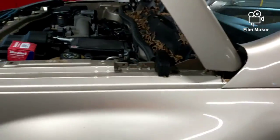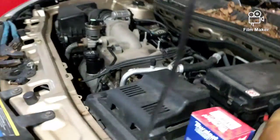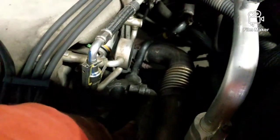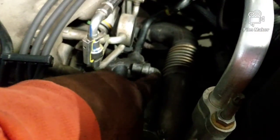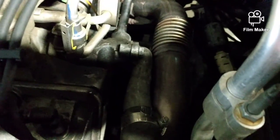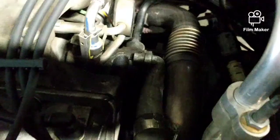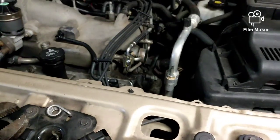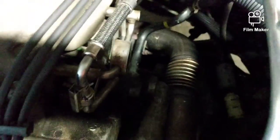On the Equinox '07, how to change out the thermostat. The thermostat is in here, in that little housing that sits right in front of the exhaust pipe. You just have one screw at the top and one at the bottom — you just have to loosen that one up, you don't have to take it out.